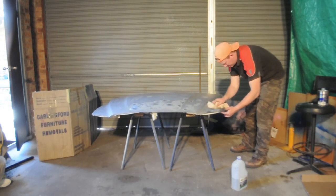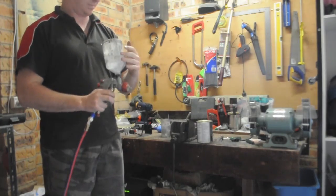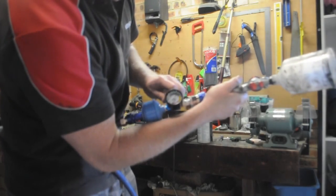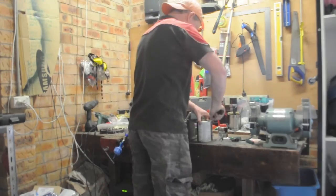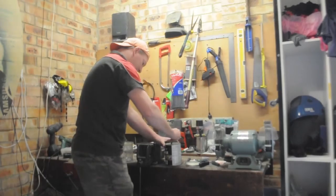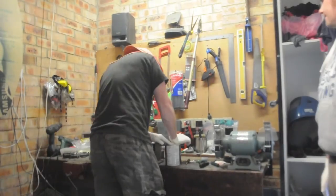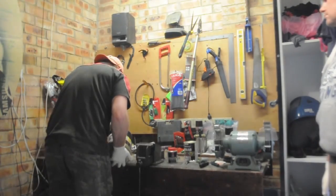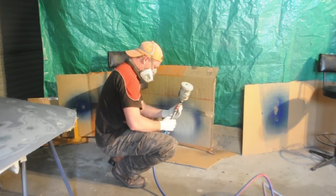We've first used water and rags, and now we're using wax and grease remover to remove anything that's on the paint. Check your own paint, but we're using 4 parts primer to 1 hardener and using about 10% thinners just to get that to come out smoother.